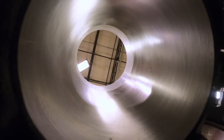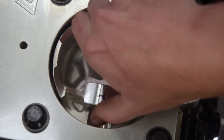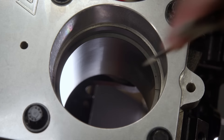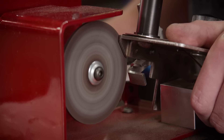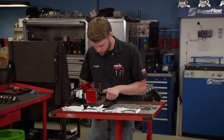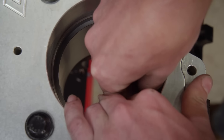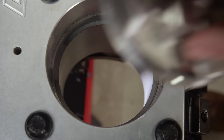With the block final cleaned and the torque plate reinstalled, we can file our Summit Pro-LS piston rings. This is a 1.2mm, 1.2mm, 3mm ring pack with a Napier-style second ring and a gas-nitrided steel top ring. Using our Summit Pro ring filer and following the very extensive instructions that came with the rings, we'll set the top ring gap at 23 thousandths and the second ring gap at 25 thousandths. Because the torque plate is installed, we'll use one of the Summit pistons with the oil control pack to square the rings in the bore.